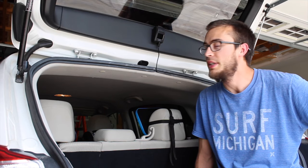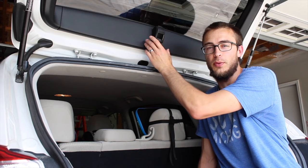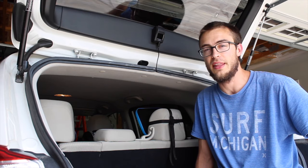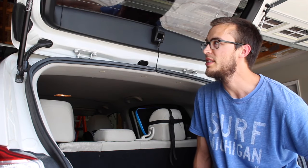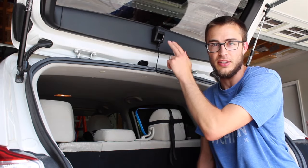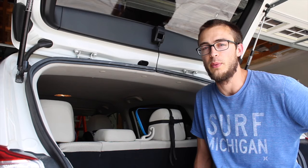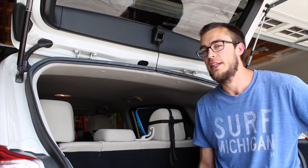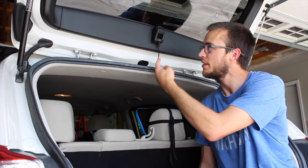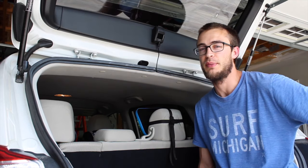A helpful tip for finding a spot: if you have a dash cam with a screen, hold it in the spot you want while looking at the screen to see if it's getting the angle you want and isn't obstructed by anything on the rear window. Also, if you have a rear window wiper, make sure the cam is in the same area where the wiper will be, so if your back windshield gets dirty you can use the wiper to clear the view. If you're mounting on the back hatch or a part that moves, make sure you give yourself enough wire so when it's open it won't pull the wire out.